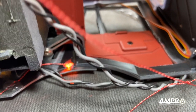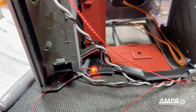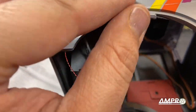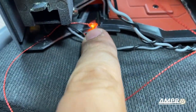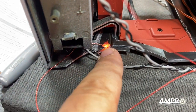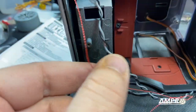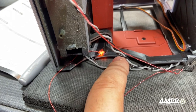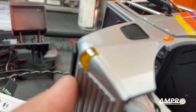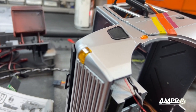I'm wiring up the front side markers. Now these are actually repeaters, but I figured I'm doing all this effort, I just want them to be on. So that's what they're going to do. These were just hot glued into place. Sorry, it looks a little weird there. I'll put a little bit of a light blocker behind it, a little bit of hot glue there because we don't want to overstress that. And then we'll route these wires. These here for the turn signals, and they just slot into the backs of these guys, which have a 3mm hole ready for a 3mm LED.